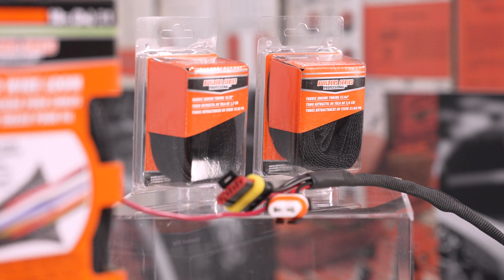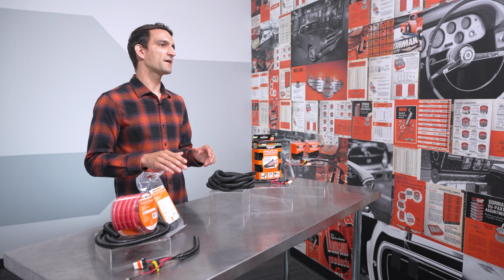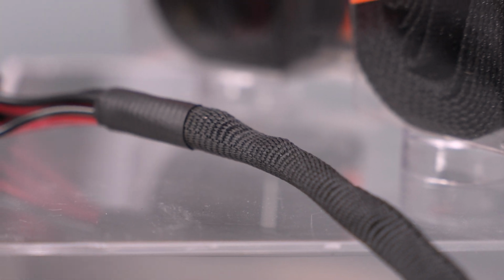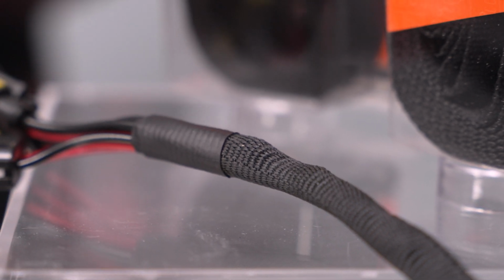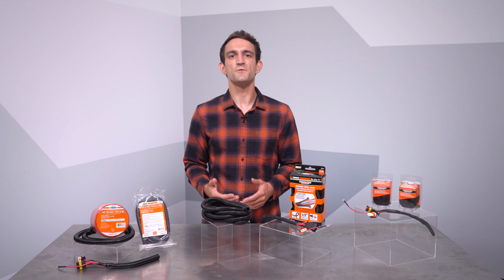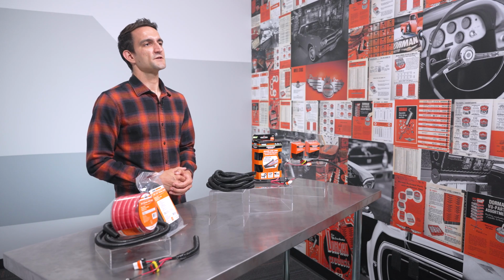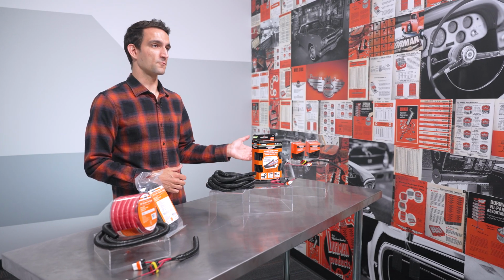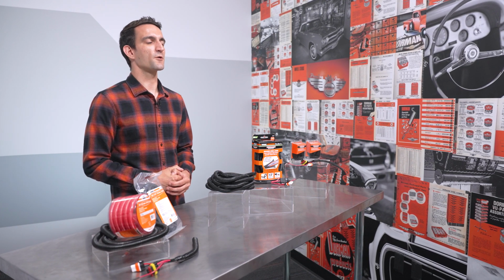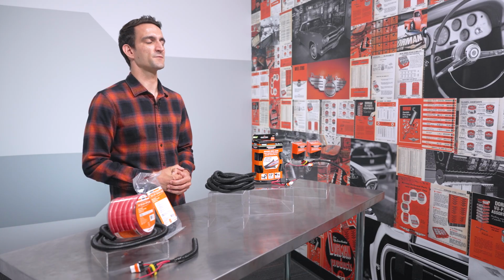Perfect for vehicle accessories like light bars and bumper-mounted accessories that might look slick if the wiring was concealed within. Due to the woven fabric construction, this loom also helps keep noise at a minimum as opposed to hard vinyl insulation. The other big benefit here is that this is waterproof. Like our braided loom, this too finishes off nicely with some standard heat shrink. Don't be afraid to use this for other things beyond wire too. Plastic pipe and rubber hose can benefit from the protection our Builder Series heat shrink wiring loom can deliver.